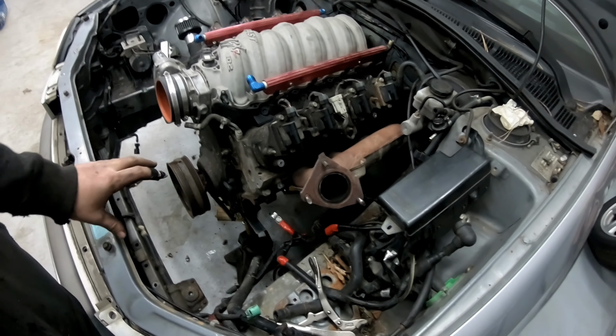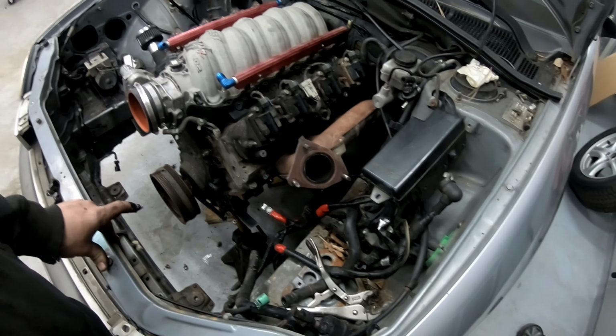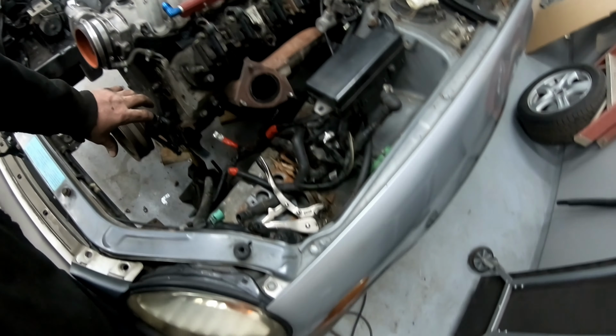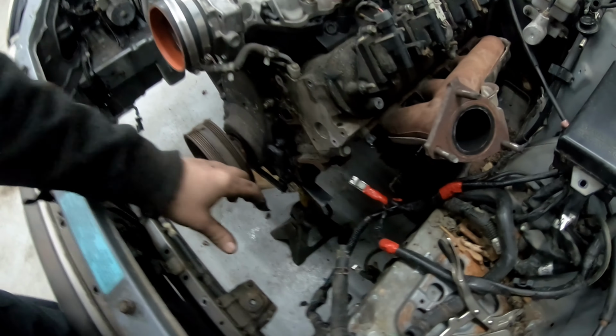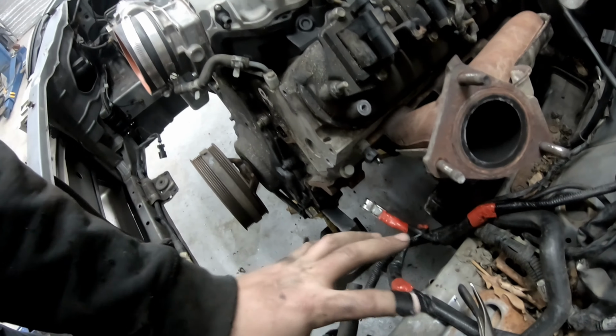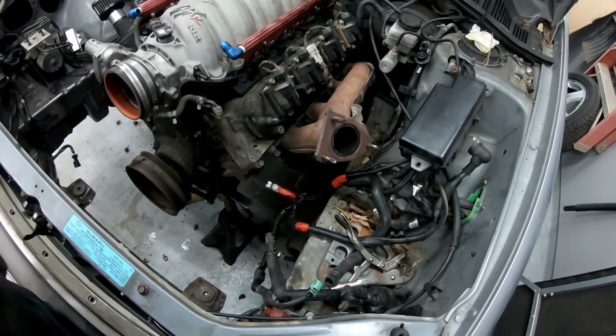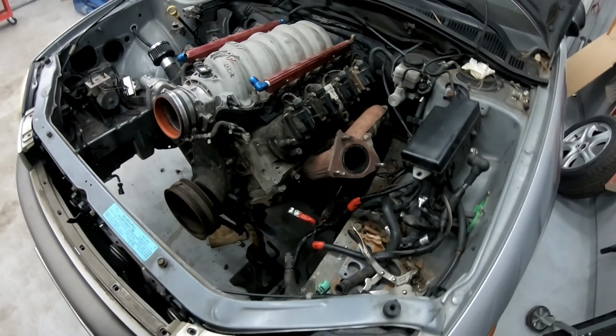And our alternator, ooh, that's going to be a fun trick. Where do we put the alternator? Because that is going to bring everything down into heat. I don't know. We'll get to that point when we get to that point. Accessories. Because normally with this particular setup, the alternator goes here. The power steering pump goes right here. So realistically, we could still put the turbo right over here. We just have to manage to maybe cut this manifold up and rework it a little bit. But not the end of the world.